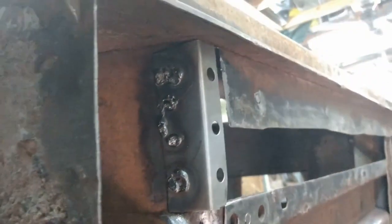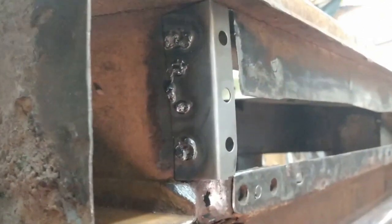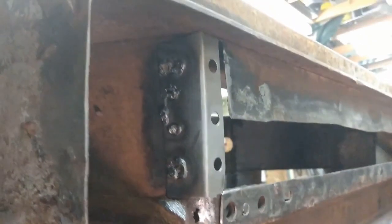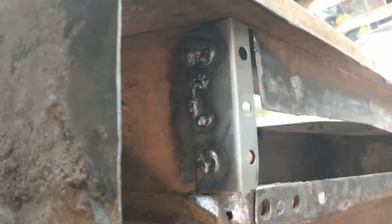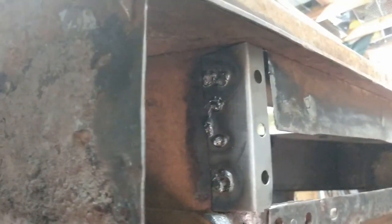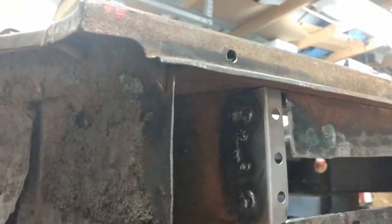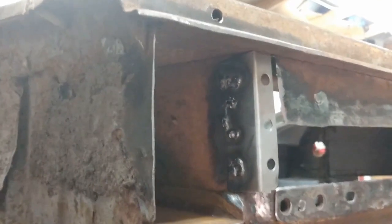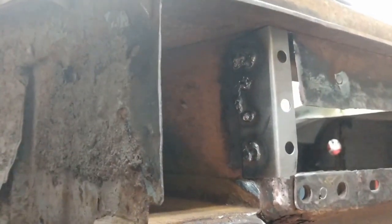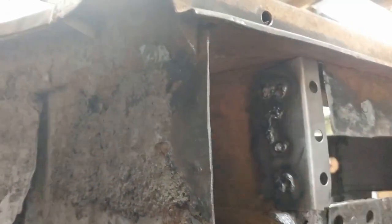So there's that patch panel welded in. The welds are okay I guess, but I'm getting a little bit more confident with the welder, so it's in there solid. That one's definitely not going to be seen, and with that in mind I'll make sure I get some primer and rust inhibitor, encapsulator, whatever you want to call it, in there. And then put some seam sealer up along this edge, this top edge here.